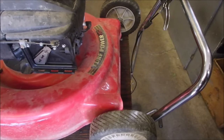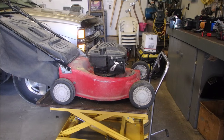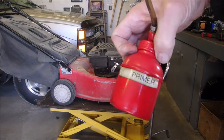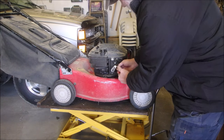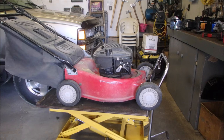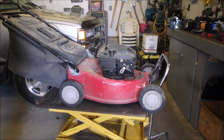Now that we're halfway home, I'm going to put a little bit of two-stroke 50 to 1 mix inside there and we're going to see if we get it fired. This is what I use for priming engines — all it is, is a 50 to 1 gas-oil mix. Let's just bend that out. Squirt. It's going to go. Okay, the throttle must be turned on low, but that's good — engine goes round and round.